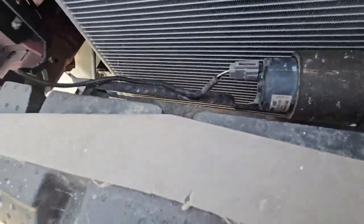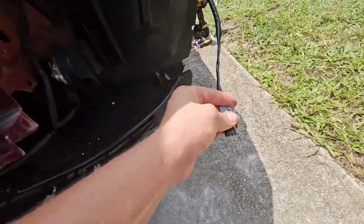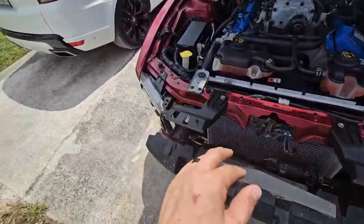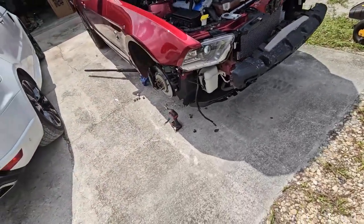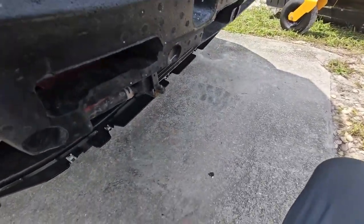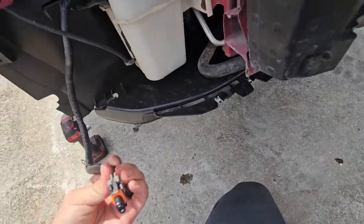Now I have full access to my little baby heat exchanger right here — you can see how small it is, she's just a little short chubby thing. Also, you've got to unplug the fog lights left and right before you walk the whole bumper off. Don't go tugging; just lift off gently here and here, pull the sides out — it'll snap out of each clip and pull right off.